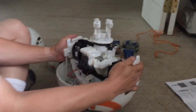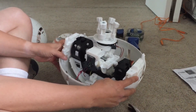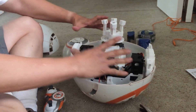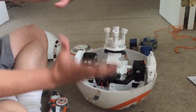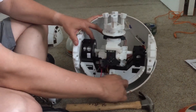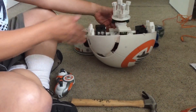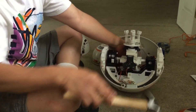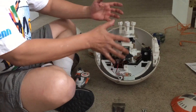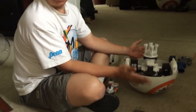This side houses the motor. Picture this as a giant wheel — the giant wheel just happens to be this entire ball. The wheel is moving and this is the motor here driving that wheel forward. Once you offset the weight to the front, the motor offsets it to the front, and the droid wants to move. Each time we push that weight forward, the droid wants to move forward. The motor pushes the weight up, the ball starts to roll, and when it stops the weight goes to the bottom and the droid stops.